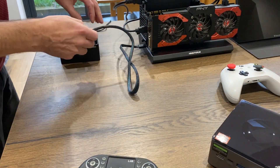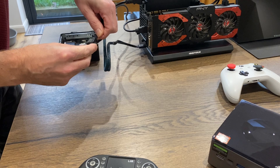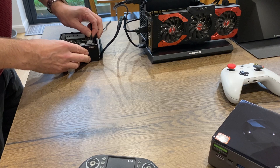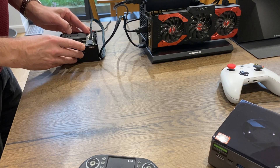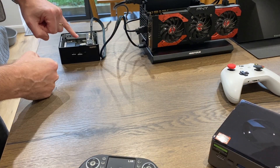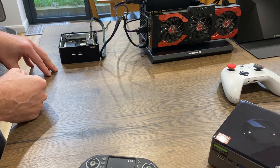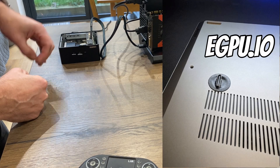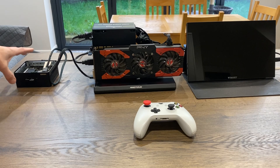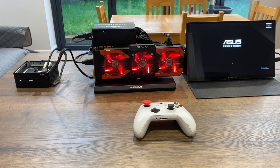It's easier to plug the cable in first and then slot it in. The Oculink cable goes in like that and clicks into place. This is just to show it working — normally I would put it back together, but the NVMe drive and the cable prevent me from putting the base back on. There are quite inventive things people have done with laptops, accessing the M.2 slot on the bottom and cutting a hole. When I switch this on, the graphics card comes on straight away and it starts to boot up.